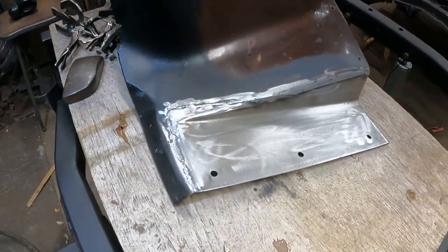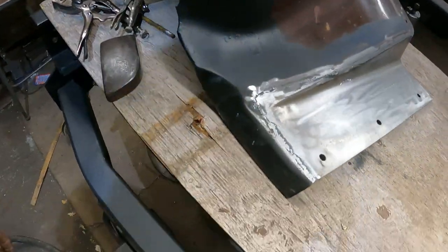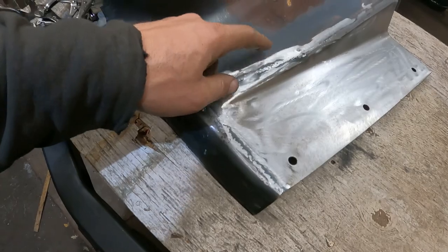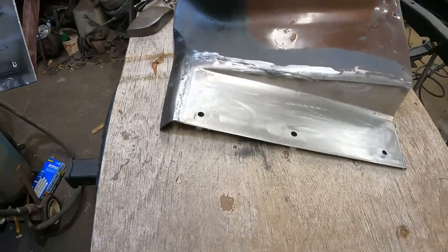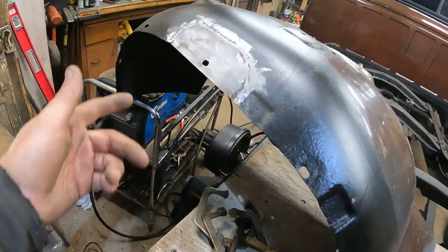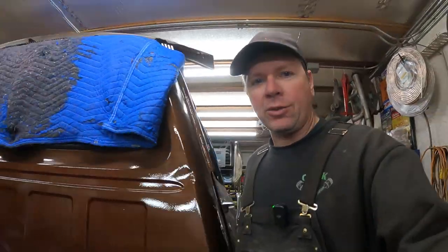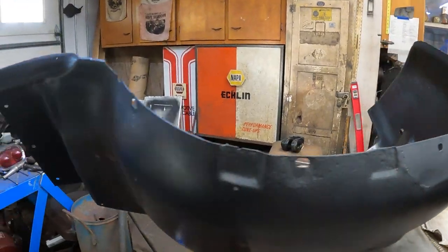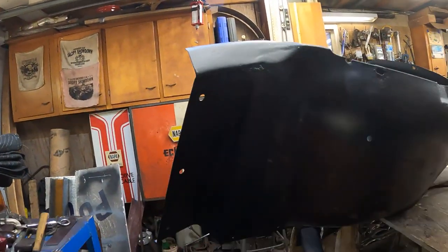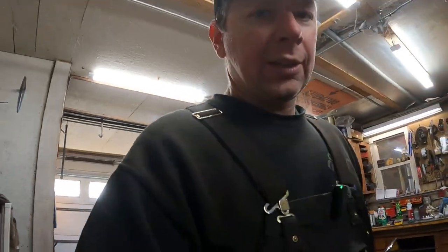It's far from perfect, but it's a thousand times better than what it was — and way more than good enough for an inner fender panel that nobody's ever going to see. It's kind of butt-welded; the gap was a little big and some of this is punky, but I got it all. Not pretty, but I'm not even going to fill it — I'm just going to blow some black paint on it. I've now repaired the inner fender panel so it can go back on the truck. Next day, the paint is drying on the inner fender panel. Revealed — it came out nice. Nice flat black. Can't even tell it's been fixed as long as you don't look at the welds. Let's get this installed on the truck and then tackle the outer fender.